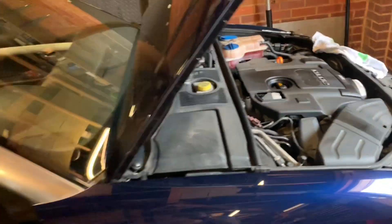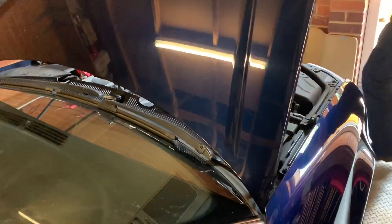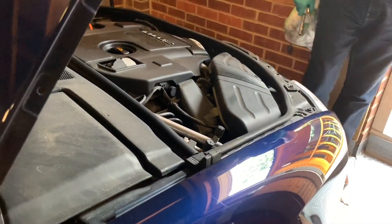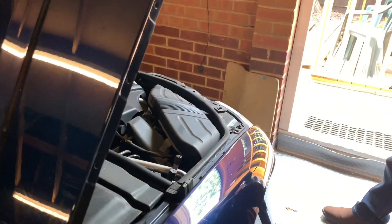You can sometimes tell by the noise of the engine. I'm not sure if you will in this video, but let's give it a go. You can hear a second order ticking there in line with the engine RPM.